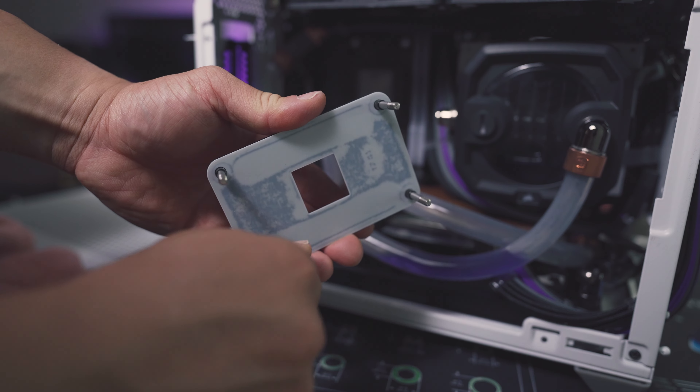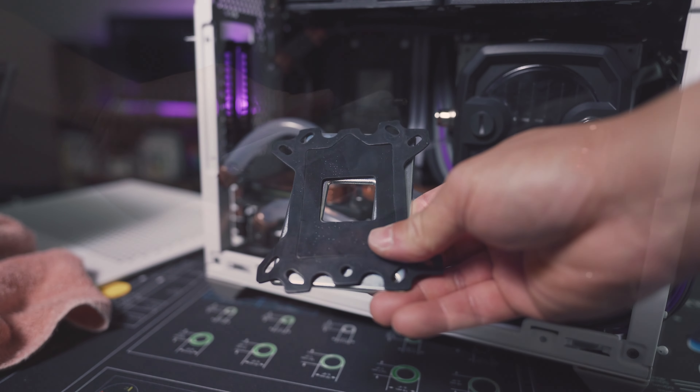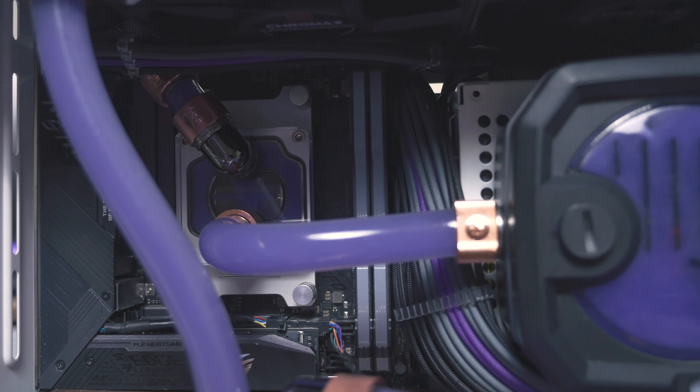All done — I swapped the blocks. Since the orientation changed a little bit, with the inlet at the bottom and outlet at the top, I did need to tweak the tubing slightly, but not a huge amount of rework. I just shortened the tubes a little. I like that this one uses the stock AM4 backplate — EK blocks use a proprietary backplate which might cause interference with some boards. I let it run for a while, flushed out all the air bubbles, and then re-ran the Blender render with identical pump and fan speeds.